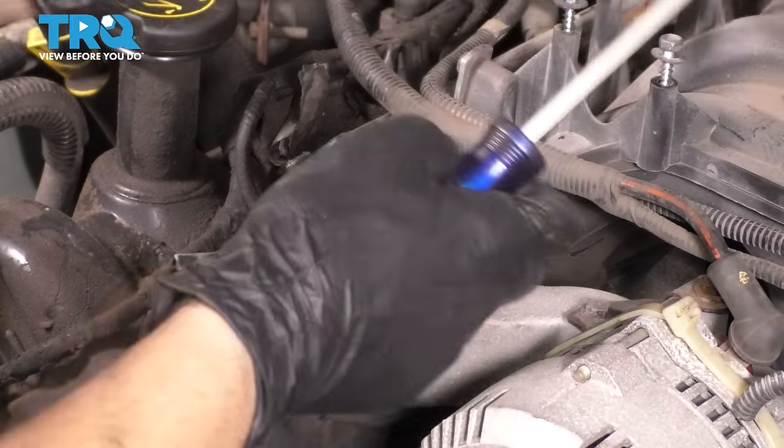So all the bolts are gonna be the same. I'm only gonna show you how to put in one. Once you put this one in, this is gonna be the front corner, so it's gonna be a studded bolt. I'm gonna grab a pick, keep applying pressure on the bolt upwards so it wants to go through the mounting hole, and then take the pick and kind of put the gasket underneath the bolt. It has a lip right here that the gasket has to slide under, and only then will it be fully installed. There we go. Twist it around, and now your bolt will stay in place. Just go around and do the same to all the other ones.